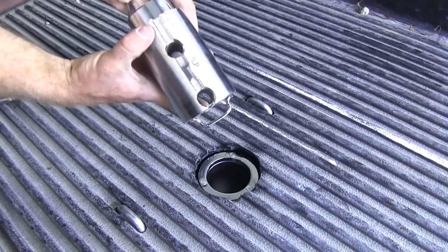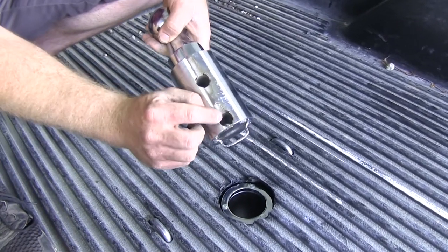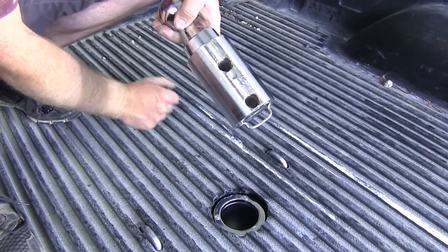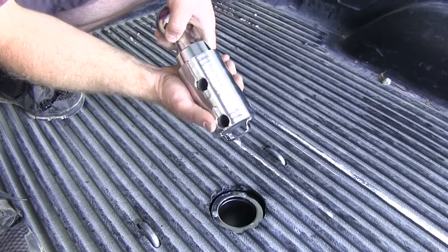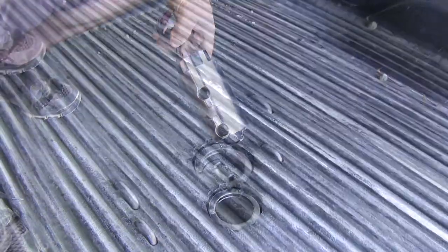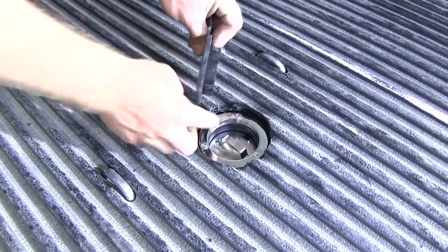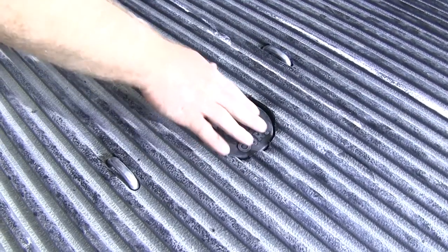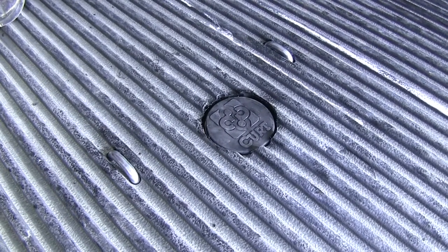You'll notice that on one side of the ball, through the two locking pin holes, there are grooves. Those are there because there's a pin down inside the hole for the ball that is going to rest in those grooves to make sure it sits at the proper depth and can't rotate when it's in there, along with those locking pins to help make sure it stays secure. When you have it stored away, it also comes with a rubber cover that'll pop right down inside there, helping keep dirt and debris from getting inside your gooseneck hitch to maintain easy operation.